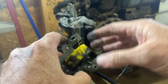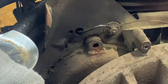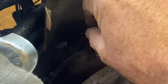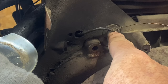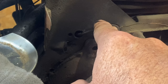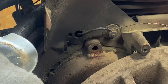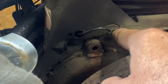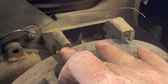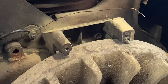Here's the old coil. I have verified — it's not real hard to do. This wire goes through here over to the points. So I'm going to unscrew this nut, take that off, and probably cut that end off, or pull it out on the other side just to keep it out of the way. This one should have a wire going up to the switch — these are grounding points. I'm just going to take some sandpaper and clean those up, and that'll be that.